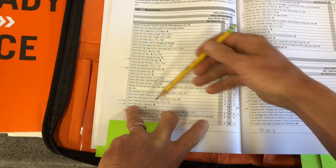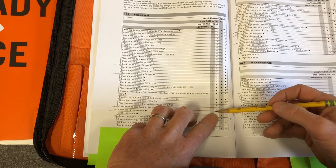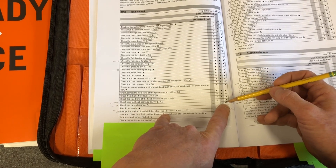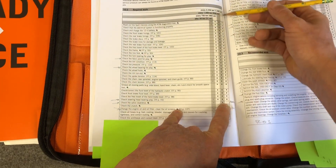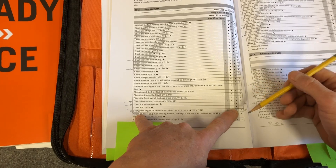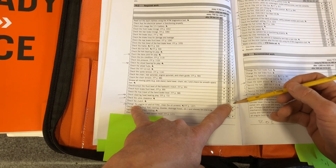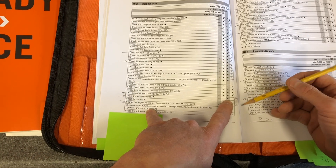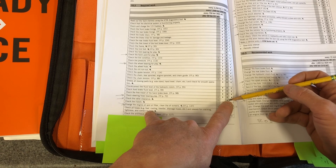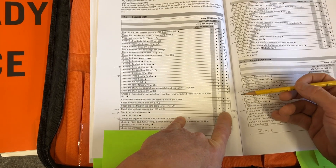On the valve clearance, they want you to inspect it at about 30 miles — I'd round that up to 50. I honestly don't check my valves on any bike until about the first 100 hours, maybe 150 hours — which is roughly 1,000 miles in the book. On my bikes I do everything off hours since they see mostly off-road use. I do my first valve check probably at 100 hours, then every 200 hours thereafter. In miles that would probably be about 2,000 miles.